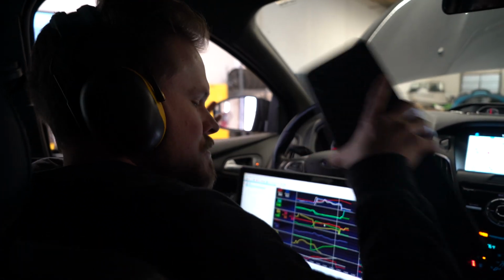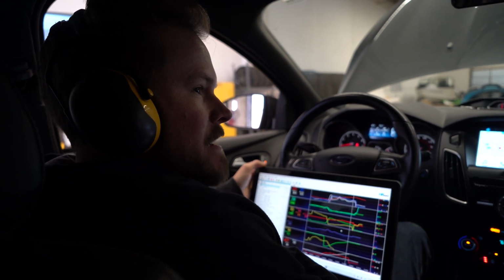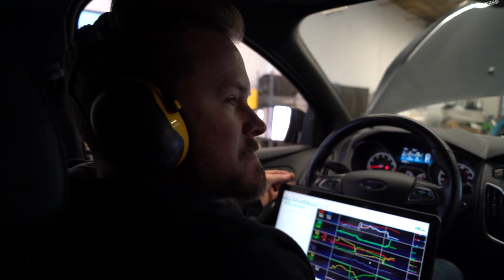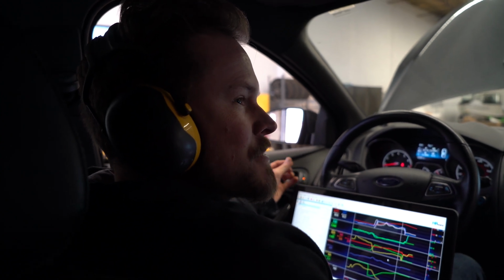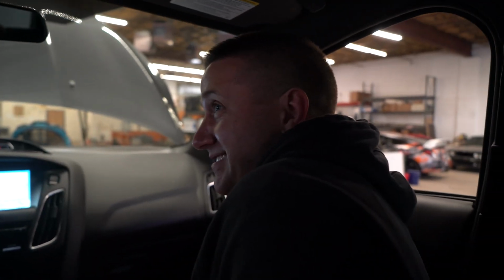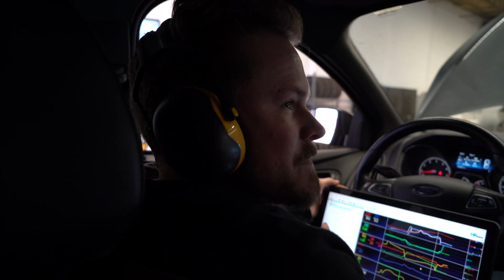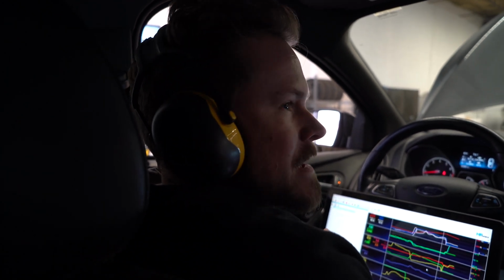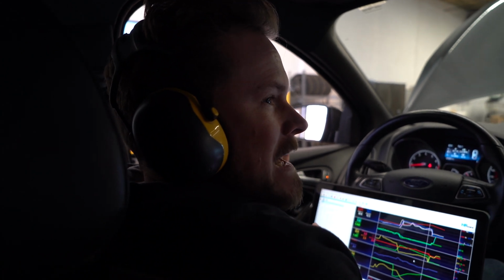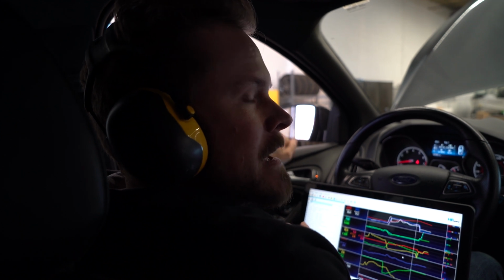That's 287 and 225. I'm kind of curious how much the summer tires are gonna give us. I've done this test once before on a Focus ST that had a big turbo, and it was 30 horsepower. Now I do think that the amount of horsepower might have something to do with the percentage gain or loss, but it had snow tires on it. I'm pretty sure Blizzaks, and I backed it off the dyno, swapped to his summer set, put it back on the dyno, and gained 30 horsepower.